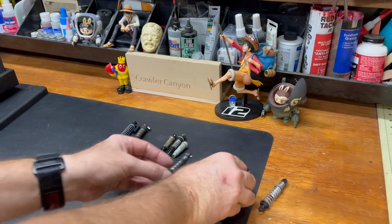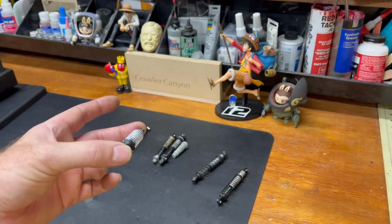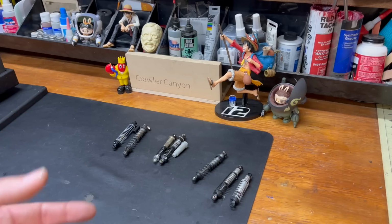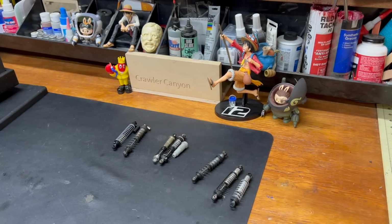A lot of shock manufacturers, to me, it seems like they assume, oh, this is how it comes. This is the spring that it comes fitted with. This is how you're going to run it. That's almost never the case. Finding a vehicle that actually works perfectly on the springs that it came with is super rare. I am scrolling through the mental database trying to think if there's any vehicle here running the springs as fitted. Maybe the Banana was running blue-gray striped for a while. It started off running them, but it still isn't now. I don't think anyone else is.